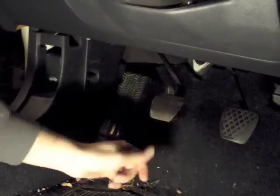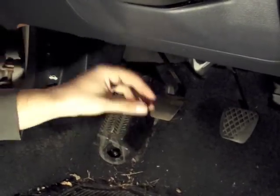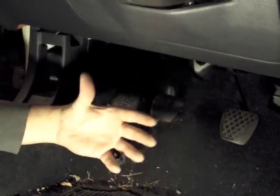I'm going to put in a camera shot, but when we see up under here — the master cylinder, where the rod goes in, is actually dripping a little bit of fluid, and that's a big problem. Basically, if you see even a slight leak, if the master cylinder looks wet, you may have a problem and may or may not need to replace that master cylinder. Mine is actually showing a little bit of a drip, but for right now what we're probably going to do is just bleed the hydraulics and see if the problem fixes. If it continues, then we may look at swapping out some parts. We're going to come around on the hood side and let Willard B show you how to get started fixing this.